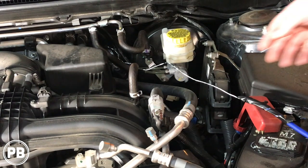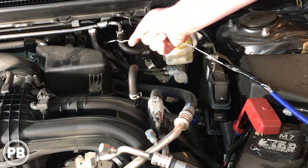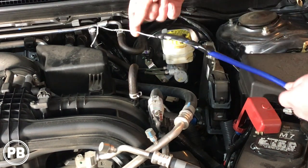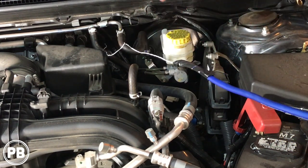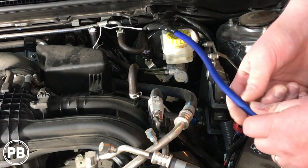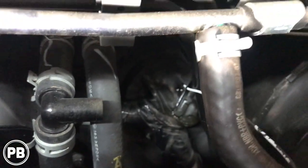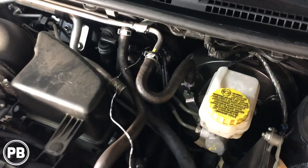We used a wire hanger to push through that rubber grommet — we'll get a closer shot. We taped the power wire to that hanger and applied a little soap and water on the grommet side, then pulled it through. It slits through the rubber without damaging any factory wiring, but allows us to make a seal around our new aftermarket wire so we don't have any moisture getting inside the car. Make sure you have plenty of clearance away from any factory wiring because you do not want to damage that.